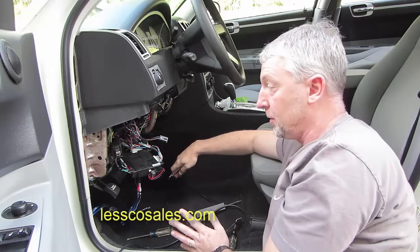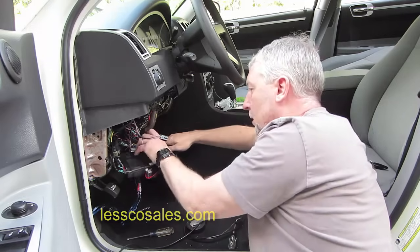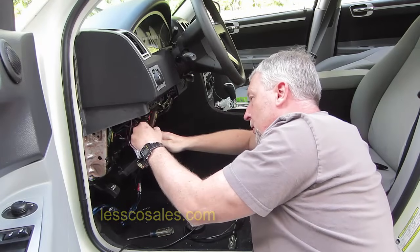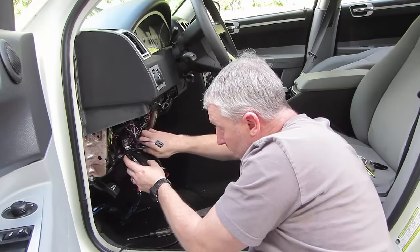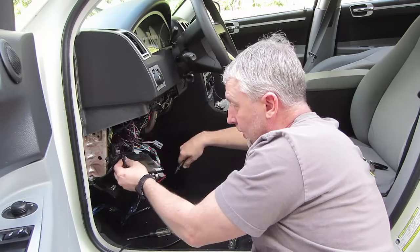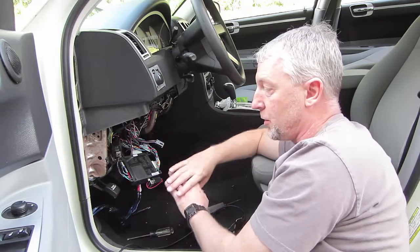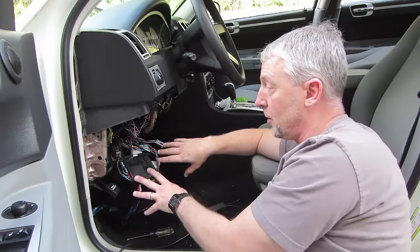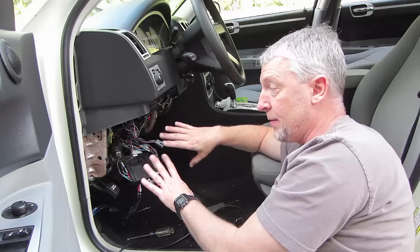It's not that big of a deal, Pete. It's really not, once you understand what all these things are. So the first thing I'm going to suggest you do is just relieve the stress on any harnesses that make it difficult for you to move around in here. Then it's never going to hurt anything if you just start unplugging the alarm harnesses, because the alarms are totally separate and isolated from the factory wiring.